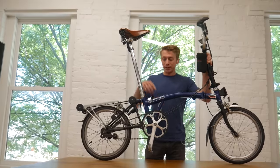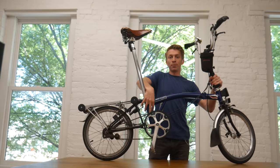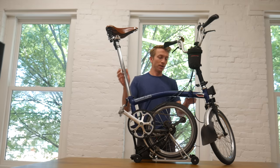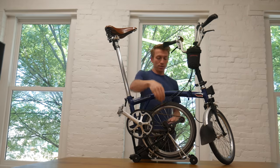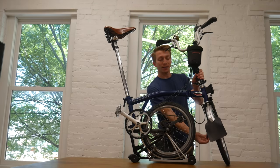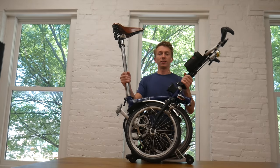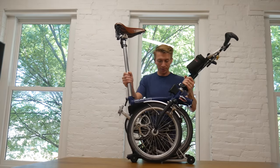Now I'm going to fold it back up. First is parking mode — there's a switch here, very easy to grab with my pinky finger, and I flick the wheel underneath and I'm in kickstand mode. I crank the handlebars back so that when I do the next fold step I can fold the front wheel back in and hook it onto the stay. There's a little plastic piece with metal that acts as the hook, and that's probably the trickiest fold — keeping your arms straight while things go back and forth. It took a little while to get the hang of but less than a week.